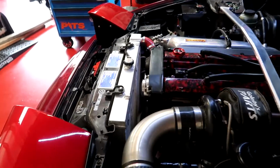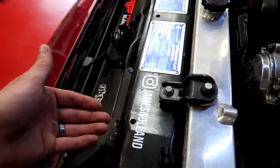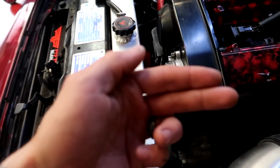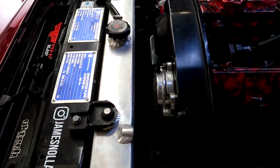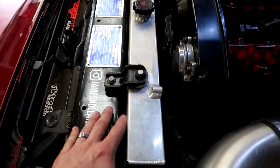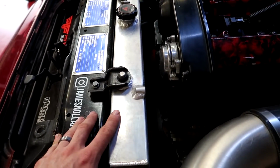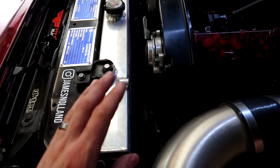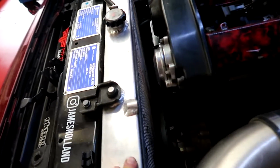A lot of people, to make room, because I don't have a fan on this side, I've actually got a pusher fan on the front, so it pushes the air through the radiator. Instead, your normal thermos will be on this side and they'll be pulling. I actually bought them brand new, and they were bloody expensive, but they work so good, like a massive difference. Really good brand, highly recommend. But the actual radiator is just eBay, so that's doing well considering.